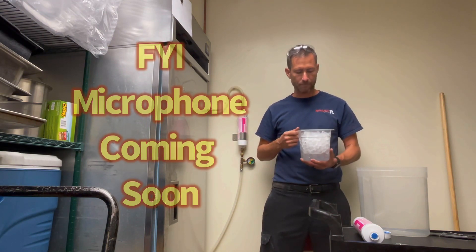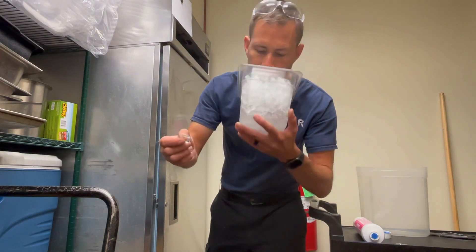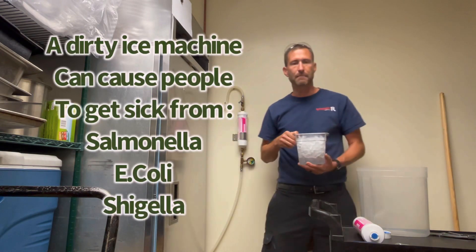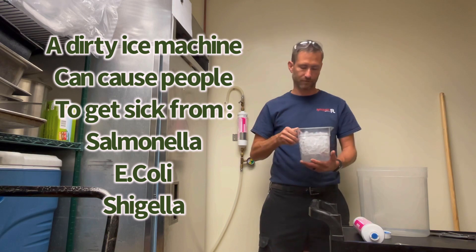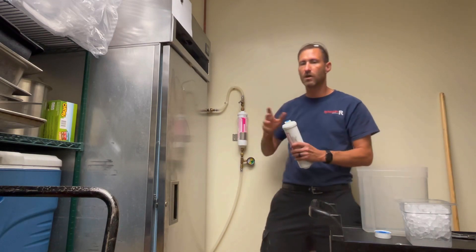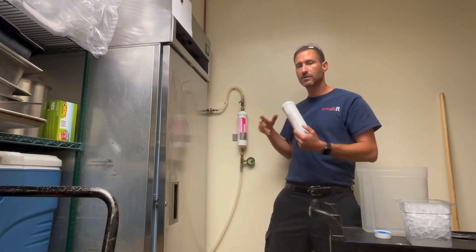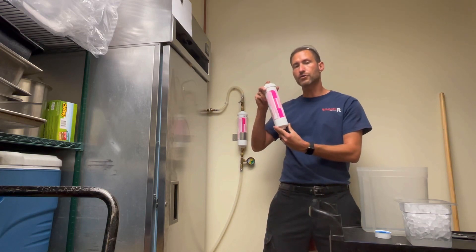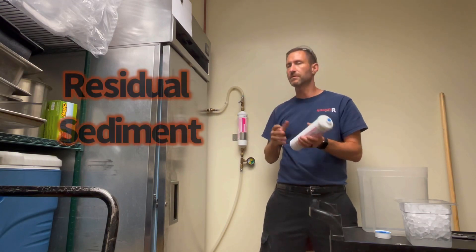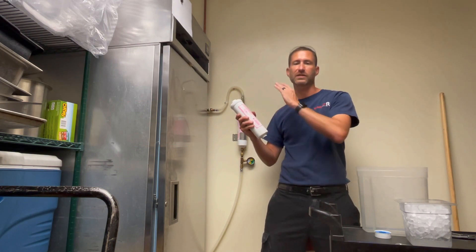It's all part of maintenance. Right now I just want to show you a visual — nice clean crisp ice, no odor to it. Everything seems fine; I have tasted it, it's all good. I did clean this ice machine not too long ago, but today I will be changing out the water filter. The water filter is right here — the ice machine is on the other side of the wall. I'm going to shut off the machine, valve it off, drain it down, and change out the filter. They require you to flush so many gallons of water because these things get jostled around and from the manufacturing process they want you to do that in case there's debris that could get jammed in any orifices or plug up the ice machine.